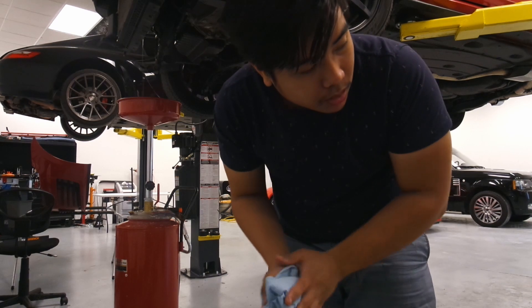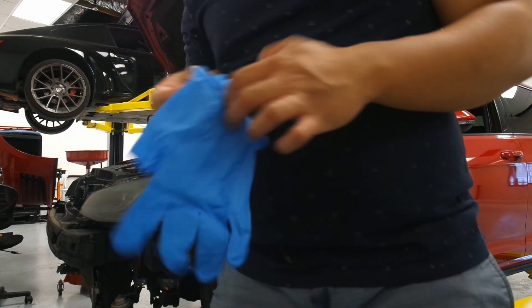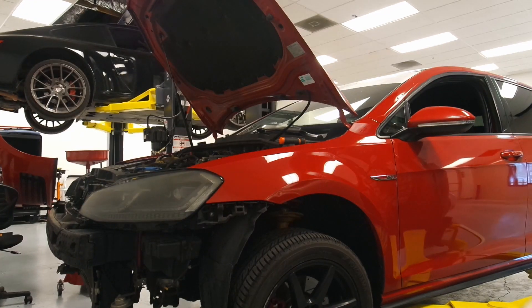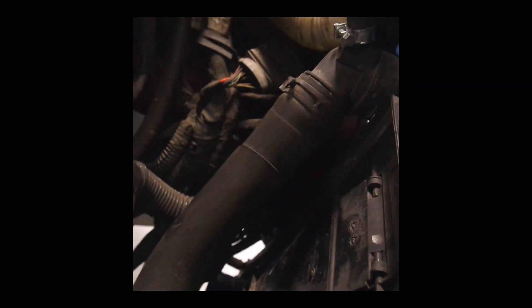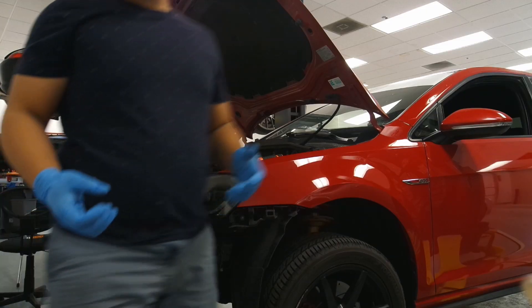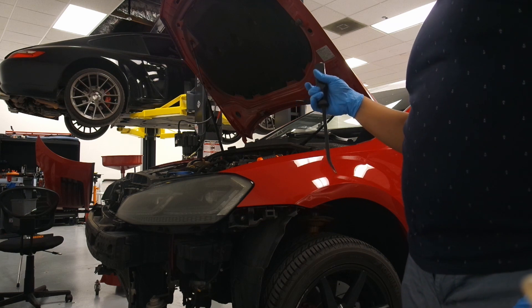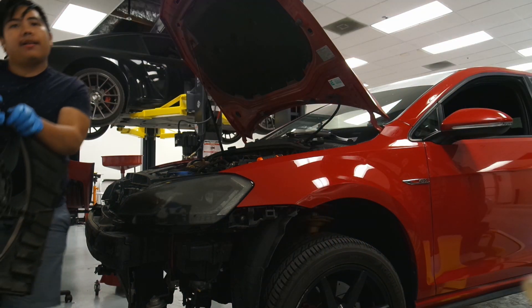The IE intercooler is like 30 pounds — about double the stock weight. We're going to disconnect the upper radiator hose now. Same thing — the quick connect up here doesn't want to quickly disconnect, so we'll take off the spring clamp and lock this hose out. Upper radiator hose disconnected. Just took off the mounts for the fan that mount it directly into the radiator. Taking out the bottom ones too. The fan is removed.